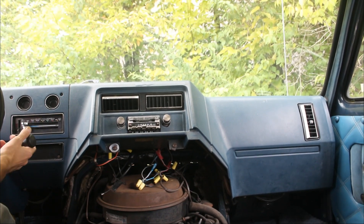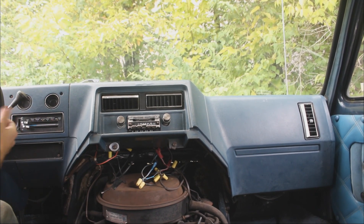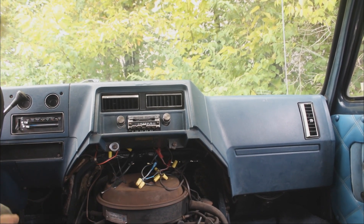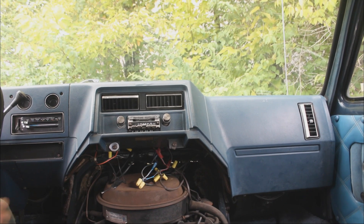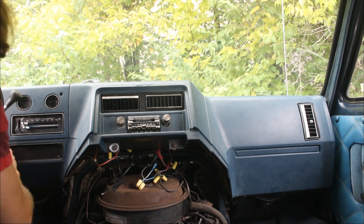The transmission's not engaging. That's not good. I want to fiddle with the trans linkage because it just seems like it's not setting down. I moved the van probably 100 feet with the trans and oil cooler lines disconnected — I didn't think about it when I did it and blew fluids everywhere.